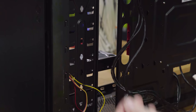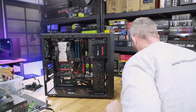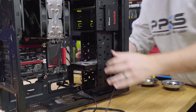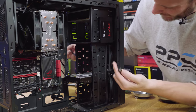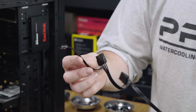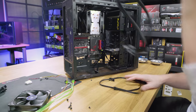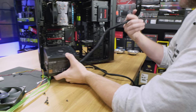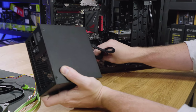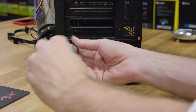This is also kind of before the era of quick release. The screw was really loose because it's fine thread — the kind you'd use on an SSD. You know this PC was bad when people were accusing me of staging it. If I was doing something just for a video I would say so. This is also before the era of being well thought out in terms of cable management. What's interesting about this cable is it has a floppy connector, two Molex, and two SATA all on the same cable. The only two things pre-wired on the new power supply are 24-pin and 8-pin EPS. I'm not too concerned about the wattage being 100W less — I know the hardware they're using. But I'd hate to do all this work and then have them tell me they got home and it gave them the magic smoke.